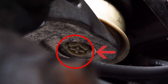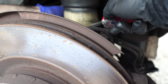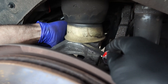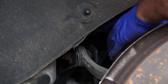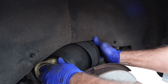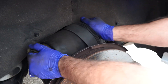In step three, go under the car. At the bottom of the air spring there's a lower mount — use pliers or a pin tool to release the tension from the clip. It shouldn't be too tough, but if you have an extra pair of hands, have someone underneath squeezing the plastic tabs while you use a flathead screwdriver from the top to pop out the lower portion. Once the lower portion is free, turn the spring counterclockwise approximately 50 to 60 degrees to pop out the whole assembly. Be careful with the air line — on the passenger side it's the blue line, on the driver's side it's the red line. It's also connected to the body through a pin, so disconnect that first, then squeeze out the air balloon.